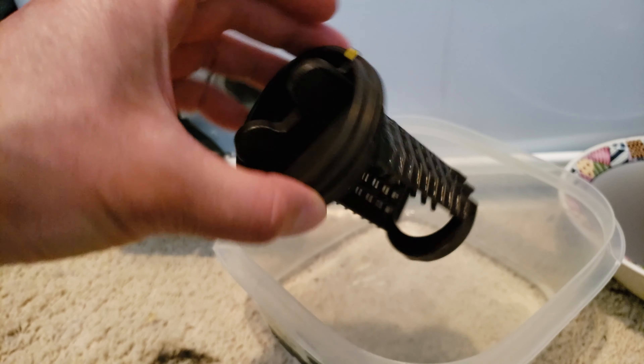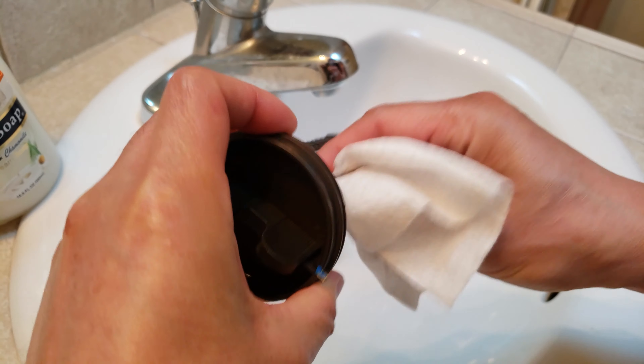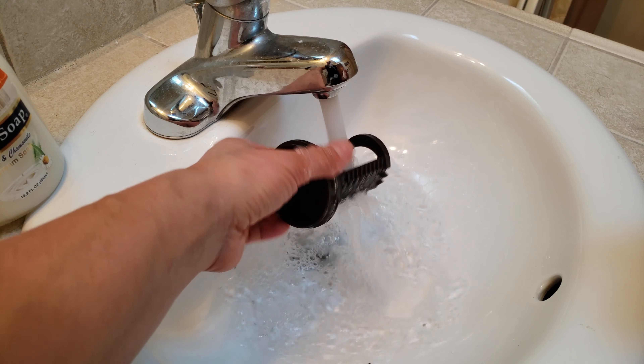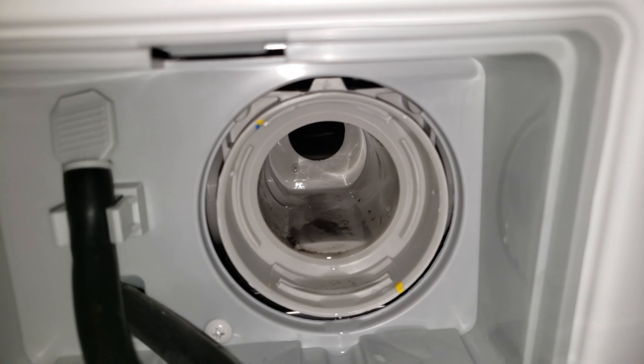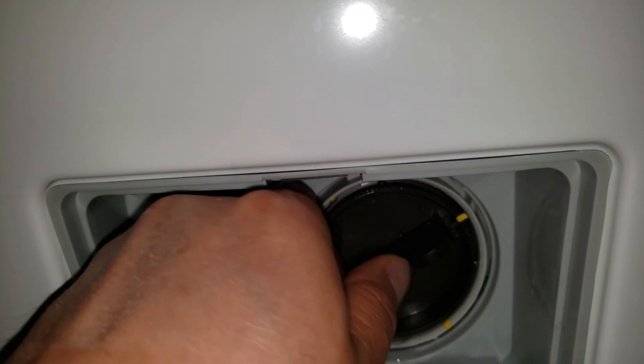What I'm going to do is just wash this out real good — remove any lint or hair. Mostly there's nothing left in there; give it a good quick rinse and I'll show you guys what it looks like inside. Put the filter back in here, rotate it clockwise and lock it in place until it's tight, and pop it back in — and we're good to go until the next cycle.